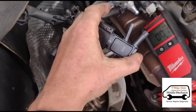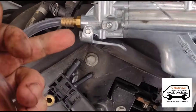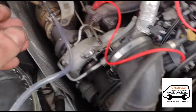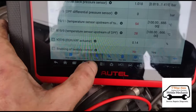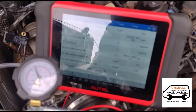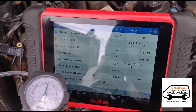We've got a new pressure sensor here, so we'll plug that in and then do a pressure test again on this one. We hook up the Mitivac — you can use it on pressure or vacuum by switching this setting. You can see the readings have already changed to 0.01. Now as I increase the pressure, the reading on the live data is increasing.